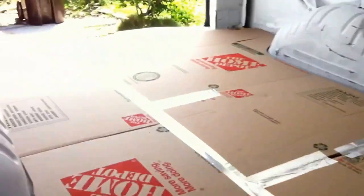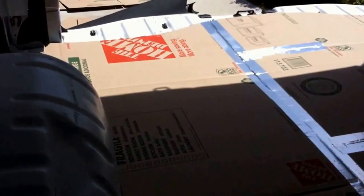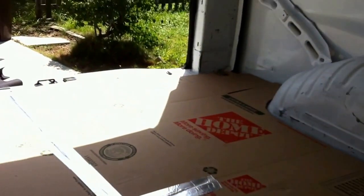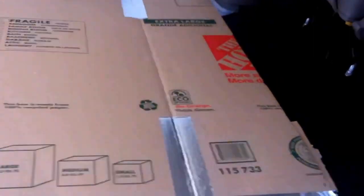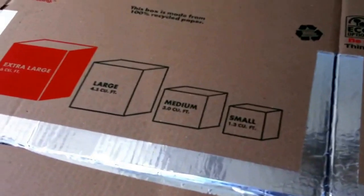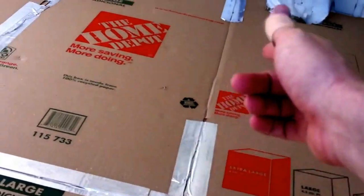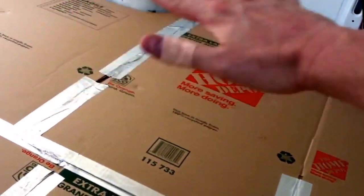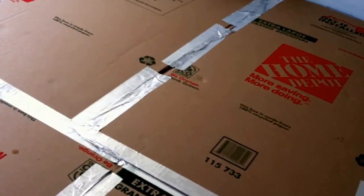Cardboard layers are in, guys. This worked really good — I only had to make a couple of adjustments. It's important to keep things where they're not super tight because it was starting to bulge, and I could push it down by the wheel well but it squeaked, and the last thing you want is any kind of squeak back here — it'll drive you nuts. I've got two layers and I tried to keep it so there's no cracks that go through both layers. Where you see a seam there's a solid piece underneath, and then the seam in that one is somewhere else. I think that's important to keep it nice and solid.